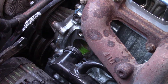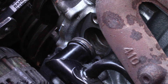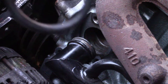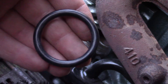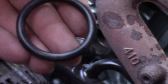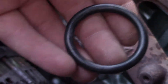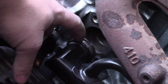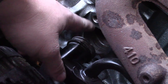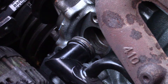I could probably get a fatter one in there. I ran out and made it just before the parts store closed, and got the next thickness up O-ring. There's the old one — it'll be a bit tough to get in there, but that should do the trick. I've cleaned this out with a little emery cloth — or scotch-brite I should say — and I've cleaned out the receiving bore. There is a bit of a groove of pitting where the old O-ring sat, but we'll just go for it.